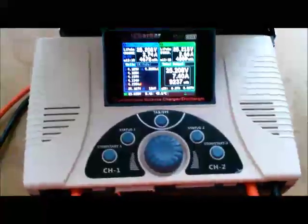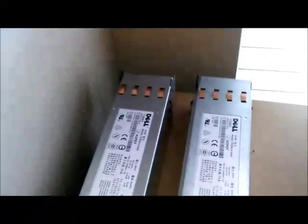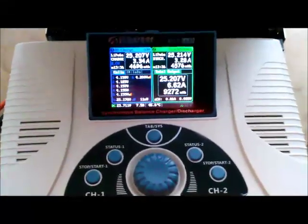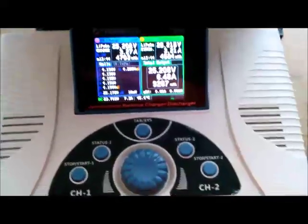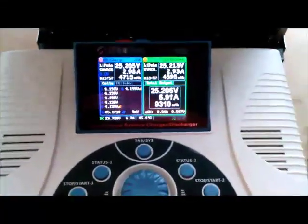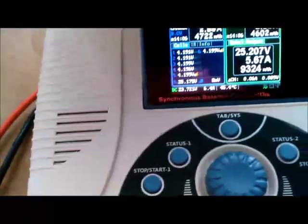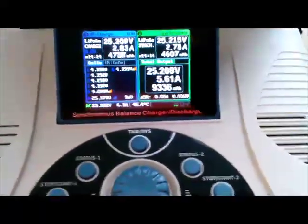If I add a third unit it can fully power this charger to its full potential, but I'm just excited I'm able to get these two because this is the most you'll ever need — this is a lot of charging power. I don't know why they'd make a charger this powerful when you can't really power it correctly without using a dryer plug or multiple circuits. But this setup works out great. It's only been 15 minutes so far and I don't know the long-term implications of running these power supplies at 65 amps and a 16-amp breaker at 22 amps, but it works in my case. Thanks for watching.